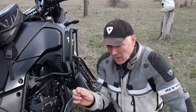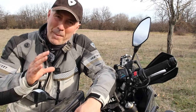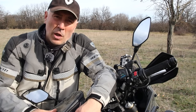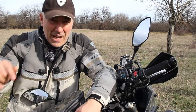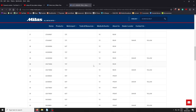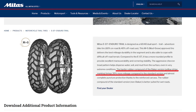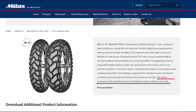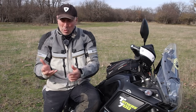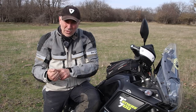I even went to another tire shop and had the balance checked again — it came up perfect at zero grams, no problem with the wheel or the balance. It's something with the material the tire is made from. I realized I made a mistake and should have bought the Continental TKC 80. After getting home I did my research — what I should have done before purchasing. Here's what I found: the Dakar version lasts much longer than Standard; the harder rubber compound gives 20% more mileage and near-complete puncture protection thanks to a reinforced carcass. However, the Standard non-Dakar compound is better suited for wet roads.